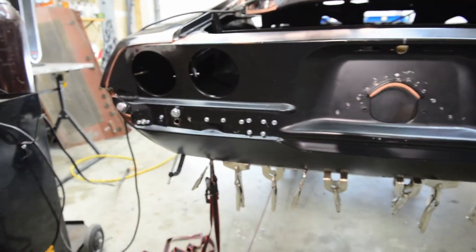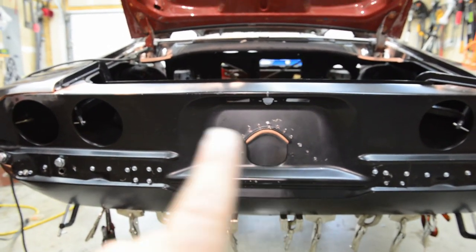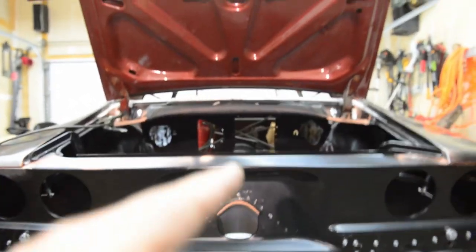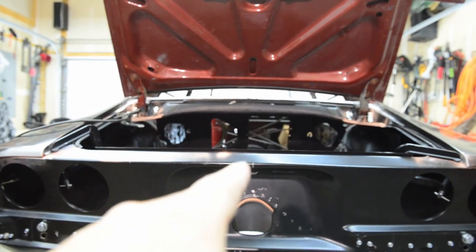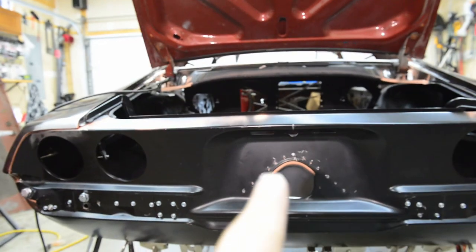All right, now I got the tail panel and air clamp on there and screwed in pretty good. I'm gonna wait to do that because I need to make the tail panel flex to the floor pan, because there's a gap probably about that big. So we got everything welded in place. Make sure the dimension from the lower deck filler panel to where I measured on the tail panel doesn't move in a little bit. So I want to weld it up on those sides there, and I'll come back and weld those.